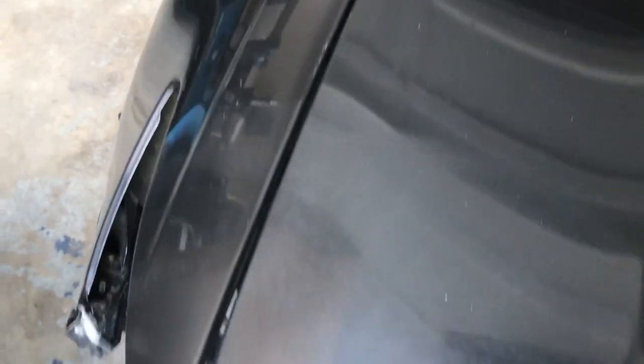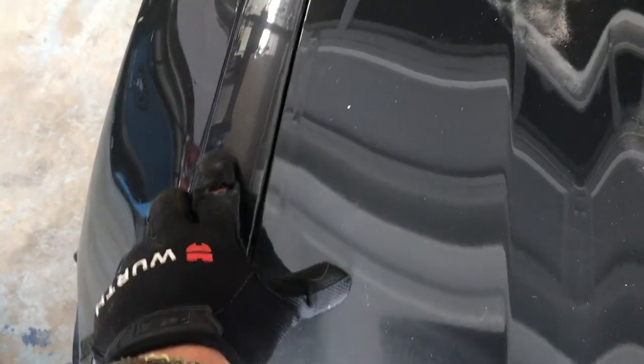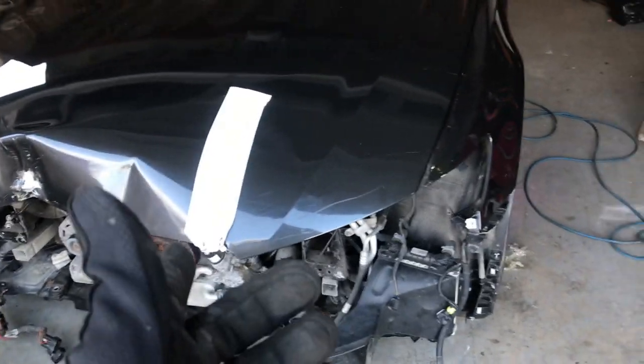Then they're going to paint the outside of the hood, and to get the best color match between the fender and the hood they'll blend the paint into the fender on both sides. The other side has no fender damage but it does have a 3M wrap on it — I'll be taking that off too, then scuffing it with probably 600–800 grit and blending it in so there's no visible color difference between the two panels.